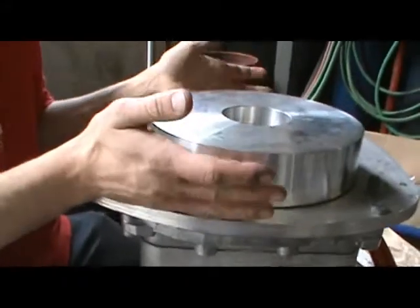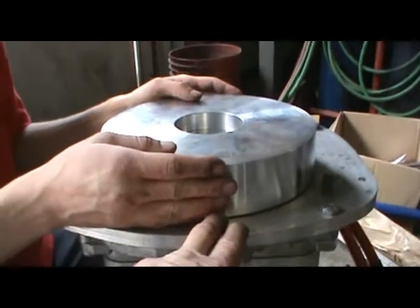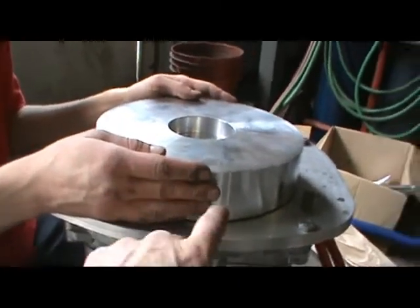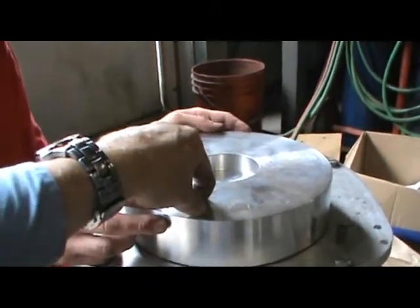It should. It's going to be hard bolted. It's going to prevent debris from easily getting in. Okay, it's going to be hard bolted. You need that extra material because you're carving another 153 thousandths here for that metal insert.